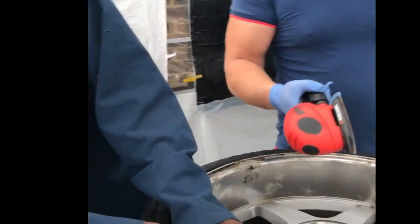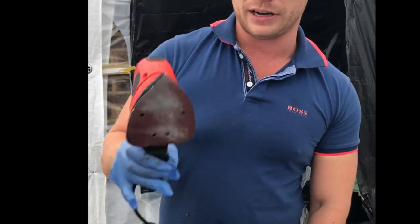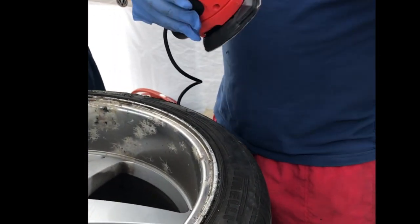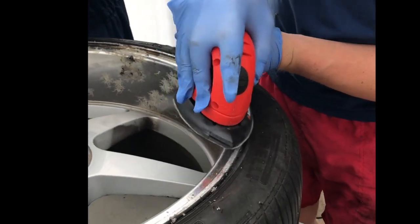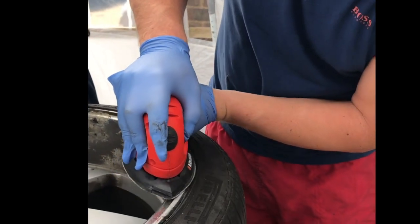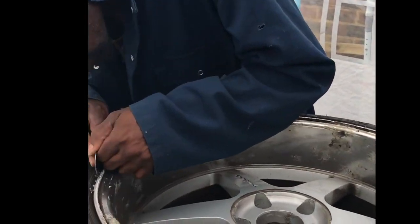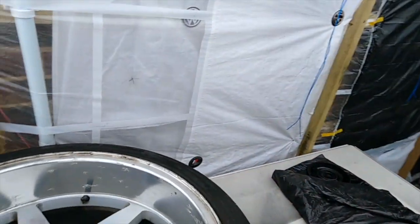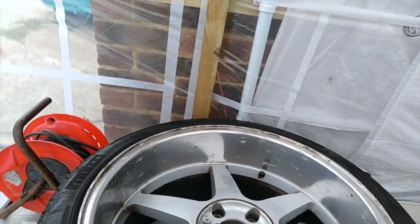While Duke is still scraping off this 3M tape residue, we're gonna start grinding out these scuffs. We're using just a simple, cheap Black & Decker sander here, because you can easily get in the corners and on the rim. So get 80 grade sandpaper and just keep going around it, flattening out all the scuffs. Just to show you how easy and cheap it can be done, I bought the sander for 15 quid from eBay, and it does the trick very well.